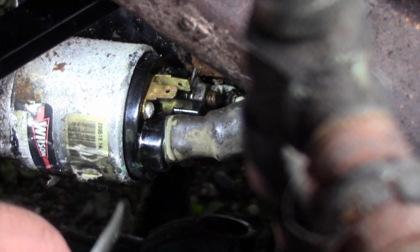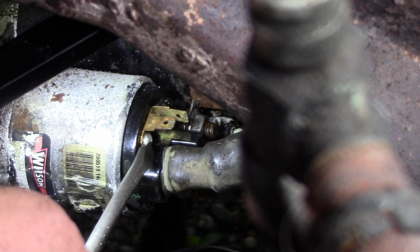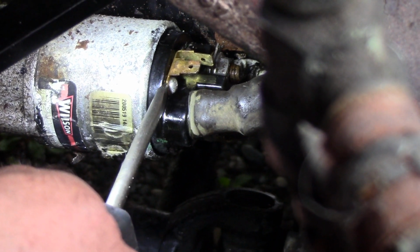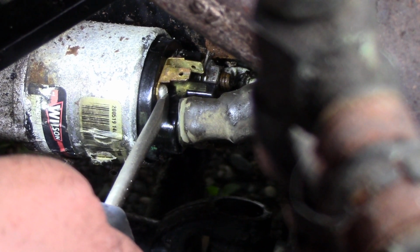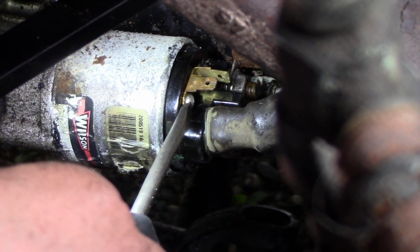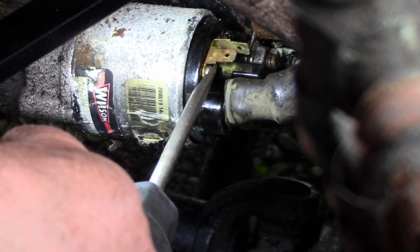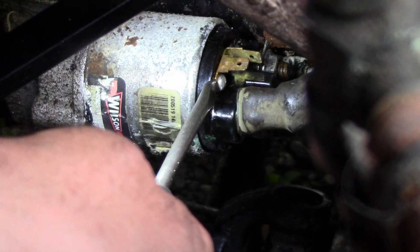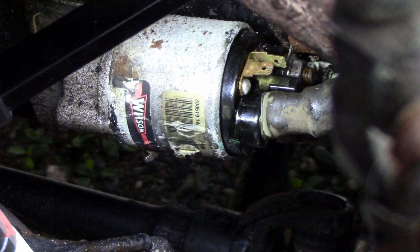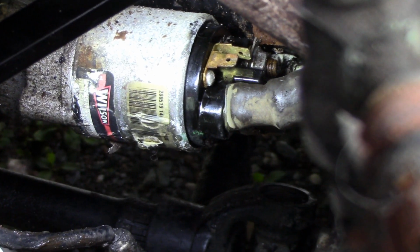It's a Wilson. But for me to get it started, I had to touch this little solder connection here, not here. You see what I mean? So there's a bad connection between there and this solder joint here. So what I'm going to do, I'm going to get my sandblaster out, just the handheld sandblaster, blast around here, clean all this lot up, and hopefully we can make a contact between there and there. That's an awful blob of solder on there, and it's holding the contact down but not making contact. So let me get my gear out.